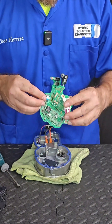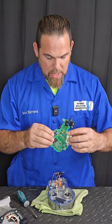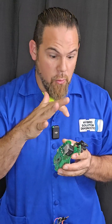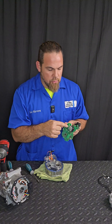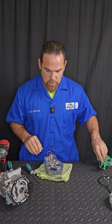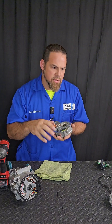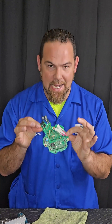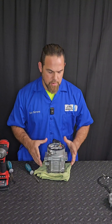I can take out the board now. The board doesn't come out that easy — you have to unsolder the semiconductors underneath. Once I turn it around, we have the main high-voltage contactor that allows the high-voltage flow inside the compressor, and finally it passes through this huge semiconductor, which is responsible for turning DC high-voltage into three-phase alternating current high-voltage in order to drive this variable speed electric motor. I already tested the semiconductor and the resistors, and these resistors are fine. The main board is perfect. This is just a motor controller or an inverter.